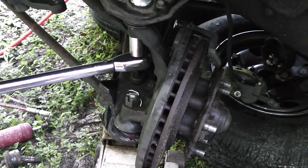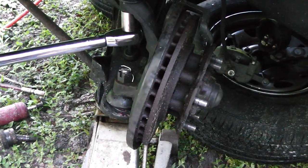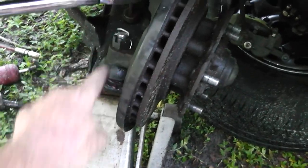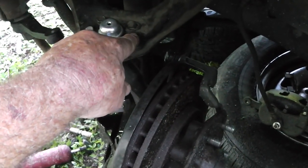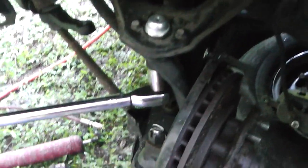I would consult your own torque specs. This is a 1995 Nissan D21 truck. What I found on the internet — I'm not saying it's correct, you can check it out for yourself — but this was said to torque to 74 ft-lbs, and I had to move it a little bit to get the cotter key in. This one is supposed to be 37. I had to remove this little bracket where the tie rod bolts to. The old nut was 22 millimeters; the new one is 27, which I just happen to have. I have a proper torque wrench here. To get this thing up I had to jack it up so it would meet the control arm. I'm going to take those old bolts out, put the new ones in, and put some blue thread locker on there so they don't come out easily. And I need to put the grease fitting in there.